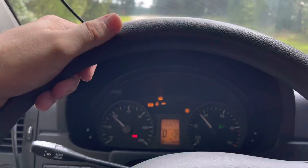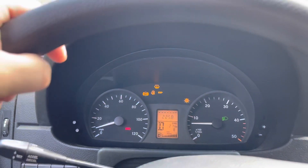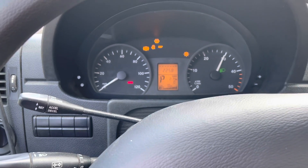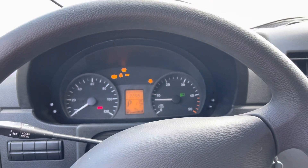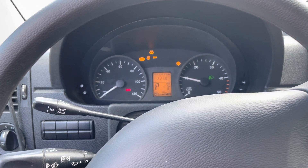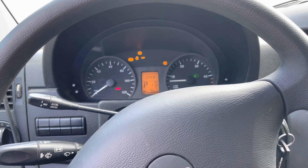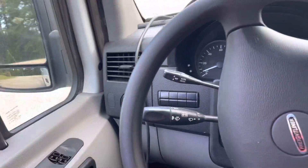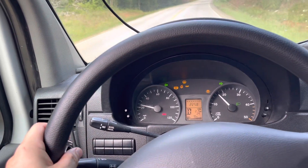This van needs a lot of work done — way too much wrong with it. At this point it's really hard to say what's causing what. You hear that whistle? That is not good — it's definitely coming from the turbo, but that same sound could be coming from the flex pipe. It's just a metal type of sound and it's really hard to get access to the flex pipe. That's definitely worth taking a look at.